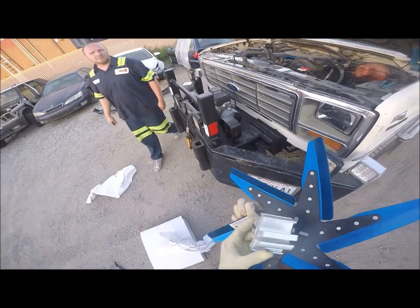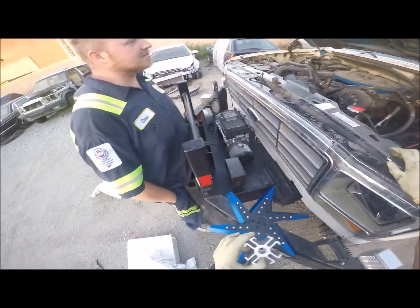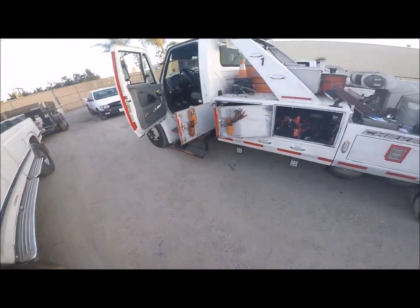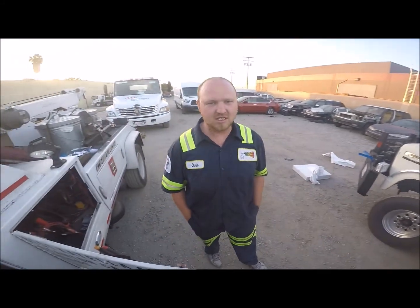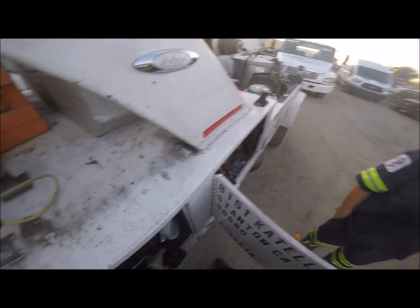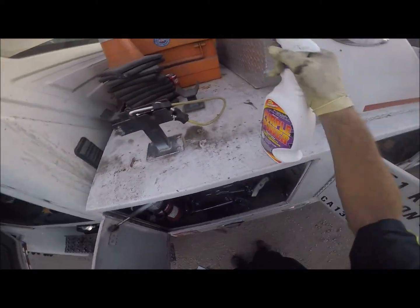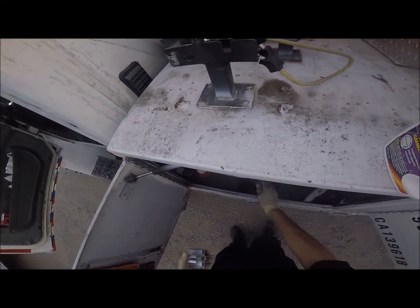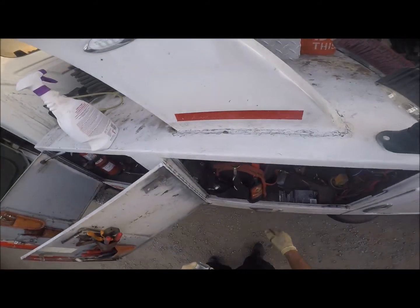There's a lady. That's not gonna work. Lady? We got lots of ladies. Same truck as yours. Okay. Her starter's stuck on. Same truck like this. Yeah, you know what that is? I tried that. Start the truck up and then disconnect the battery, the starter wire from that. That or the starter itself is staying engaged, in which case you just get a new starter. You can try hitting the starter on those. I tried that already. And sometimes that works.